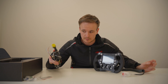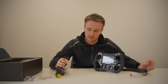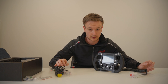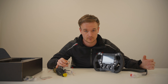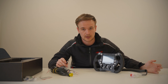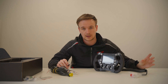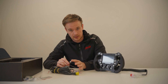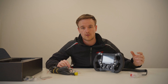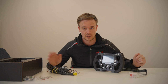When you buy the wheel you need to purchase the additional loom, which connects into the wheel and provides all your switchgear for the paddle shift and input switches. You have also got CAN expansion — as with our other products — for GPS, camera connection, and anything like that. If you want to run analogue sensors directly into the wheel, you would buy our channel expansion box, which connects directly in so you can feed analogue inputs straight into the wheel. Therefore everything is recorded in the data logging feature of the wheel and you don't need any additional data loggers.